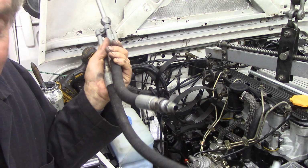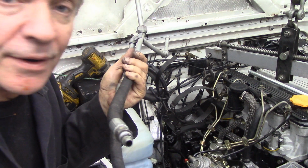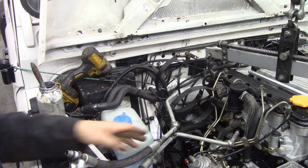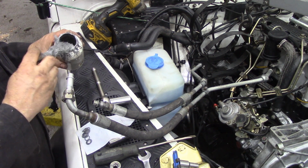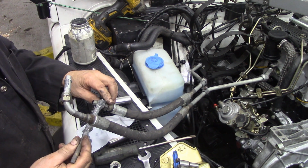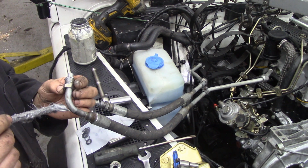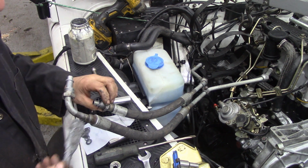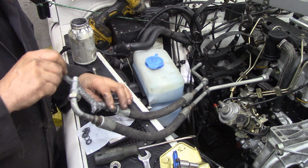And if you strip the thread in the housing, that's the injector pump off, because the bolts are behind the injector pump and they're a bitch to get out. What I'm going to do to prep these up, just a little wee bit of thread guard on there, thread guard on here, maybe a bit on the nut, why not? That's just to stop the muck and the oil getting in behind them, and water getting in and things like that.